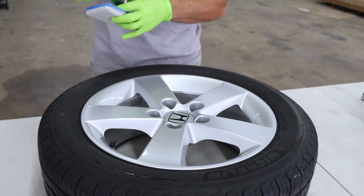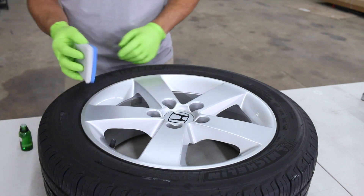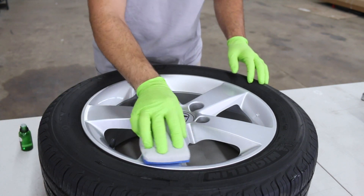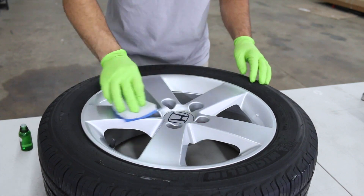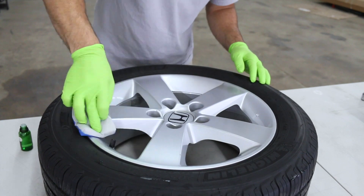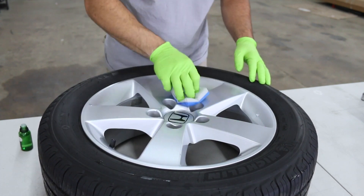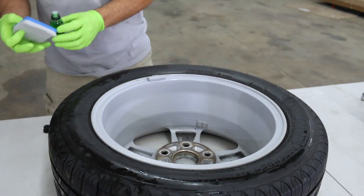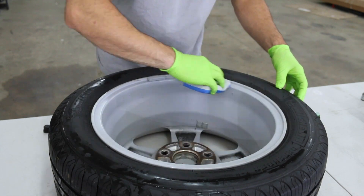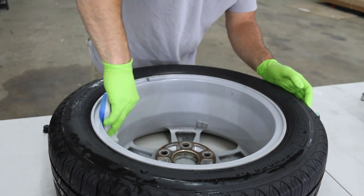Once all your wheels are wiped down with pre-coat, you're finally ready to coat. I'm using the suede applicator by Autofiber — I'll put a link in the description below. On the first application, I apply quite a bit of product onto the applicator; as you go, you don't have to apply quite as much. Then it's pretty basic — just wipe it on. I'll let it sit for anywhere between three and five minutes before I come back and wipe it off. If it's a really intricate wheel with a lot of grooves and crevices, it's easier to spray the coating with a paint gun or even a cheap airbrush you can buy off Amazon.